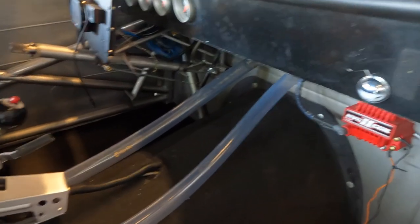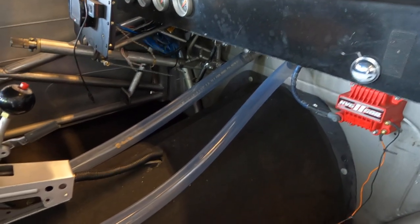These two clear lines are my breather burn-down tubes from the valve covers — they go into the back. We do not put puke tanks in the front of our cars at all. All of our puke tanks go in the back behind the slicks, so that if something happens and we dump a bunch of oil in the puke tank, I'm not running through the oil. I see so many guys with vent tanks and overflow tanks up in the engine bay area — that's just a huge no-no. Especially if it's an engine crankcase, it really should be behind the wheels.